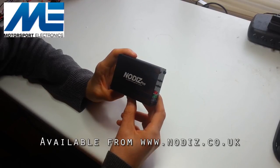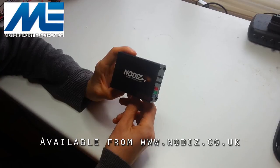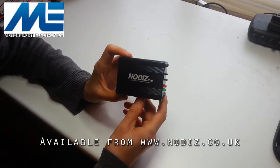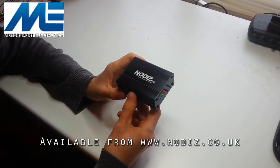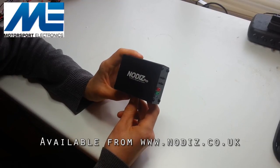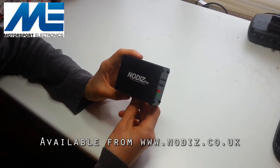It has inbuilt launch control, Bluetooth communications with the Android digital dashboard app for monitoring the engine and use in kit cars, hill climb, and sprint cars. It's incredibly small and easy to set up with a great feature set and a great entry point into aftermarket engine management. For carburettor-based engines it can replace older distributor-driven setups — for example, old Triumph engines — or be used on engines without a distributor drive, such as Vauxhall, Ford Zetec, or Duratec engines, using standard trigger wheels.